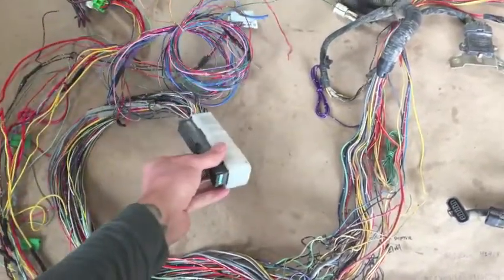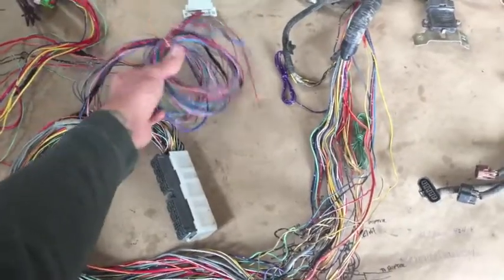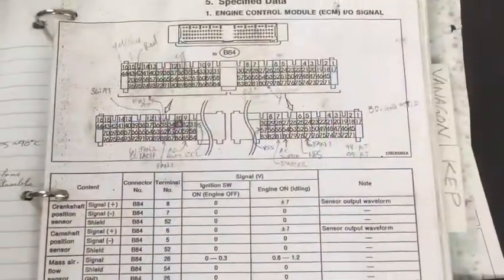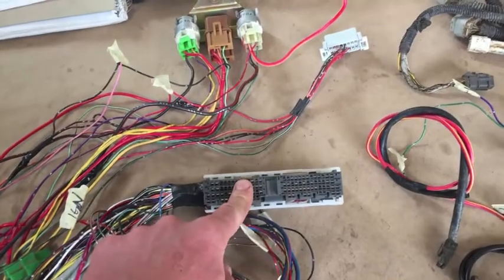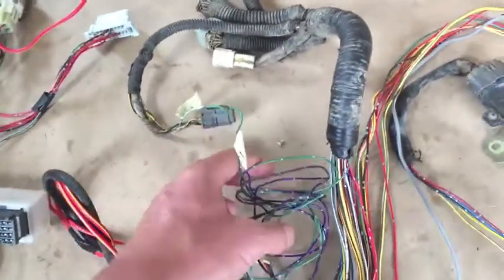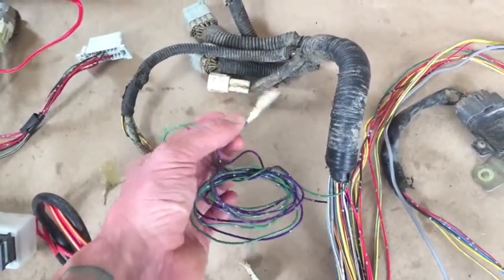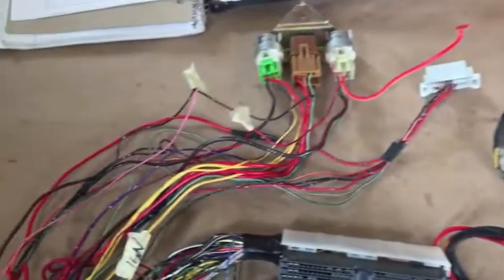Now it's time to identify the wires that were loose but terminated in the ECU connector. I'll put a link in the description to an ECU pinout chart — that'll help immensely when you're trying to identify these. Using that, I was able to identify the wires that terminated at the ECU connector and also from the engine connectors. In the 95, we have a purple and a green wire — the purple is the water temperature gauge and the green is the oil pressure switch.